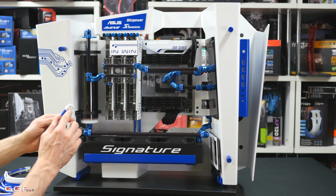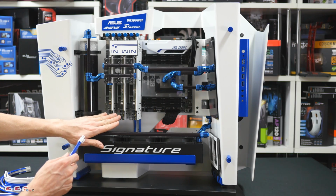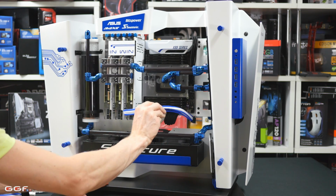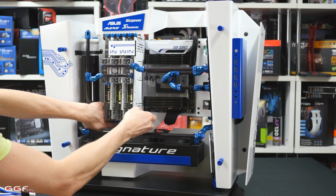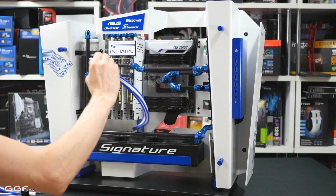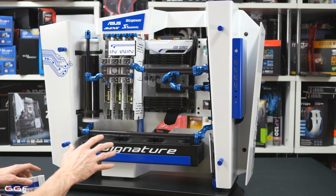Now one more thing to look at with these is the latching connector on the top of the plug, especially with video cards. In an orientation like this, I've got a little bit more relaxed setup because I can do these 2 ways. At the moment, these will be going this way. That's the way that the curve is formed. But because I got these long enough, I can also form these to go like this and curve around the back and go into the back hole like this. But bear in mind, if you do have a smaller case and you are running shorter cables, you don't really have as much playroom to twist the cables the opposite way. So what I'm going to do now is throw the GPU cables in, and I'll show you which way I went and why I went that way.